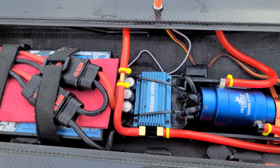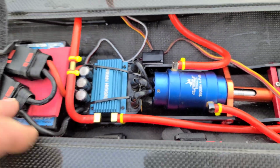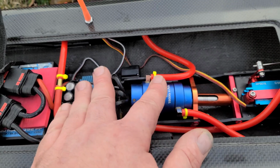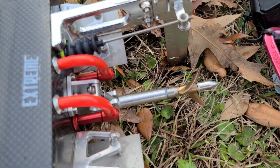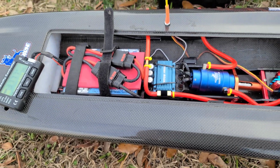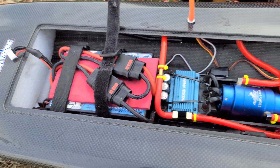They're discharged. I actually like the ESC on this boat with that 1900 kV motor. Bashing it around, not so good, but I think it's gonna be a boss setup for the speed run spot. It actually had some good out the hole takeoff with that 40mm prop. It surprised me. So prop this boat right with this setup, we might be good. Keep those temperatures down. That's something I need to be conscious of. But we'll get it worked out.